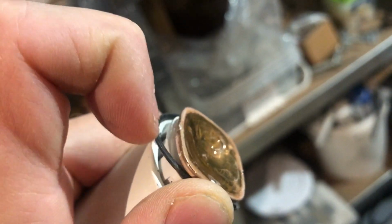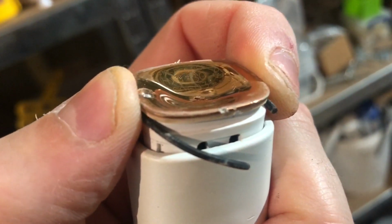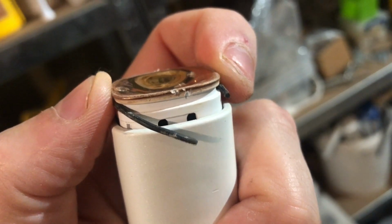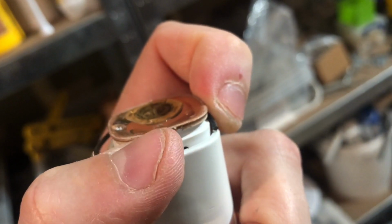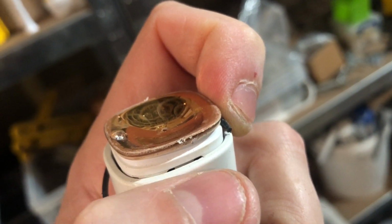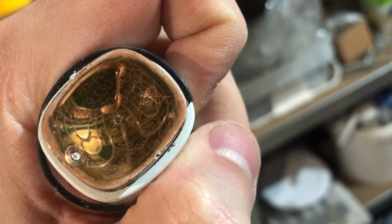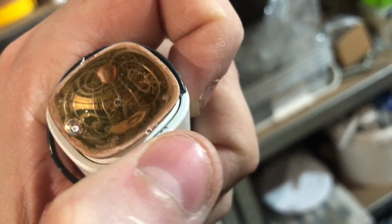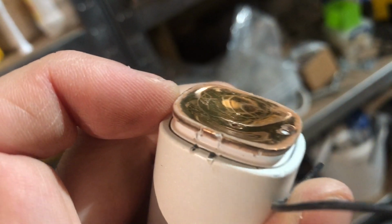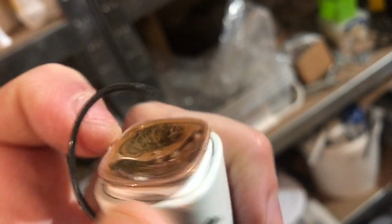But now you know that this seal is here, you can try to not break it. That is lesson number 1. Try to not break this seal. You can probably manage to not break the seal by just gently easing it up. First on that side. So basically you shove a very, very small flathead screwdriver in down at that angle, straight down on one side. You gently lift it up just below that lip. And sorry I'm not showing you, I haven't got enough hands and I don't have a rig here to show you. And you do the same again on that side,